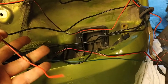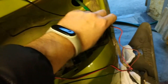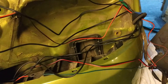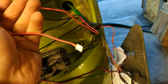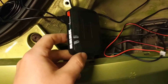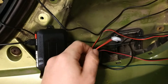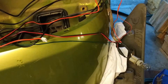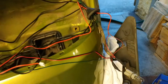The other part is already stuffed through this rubber sealant here that seals the entry point to your interior. The other wires that you need to connect to power is your power supply for your parking sensors. You have the brains of your parking sensors, and this power goes to this socket here. I have done all the power connections I needed. Now I can seal everything up, tidy up and move on.